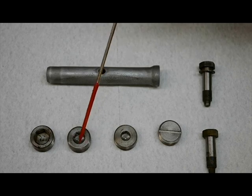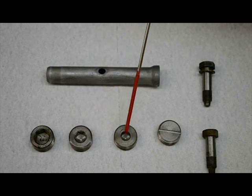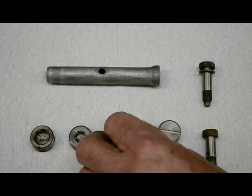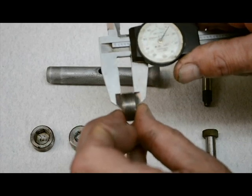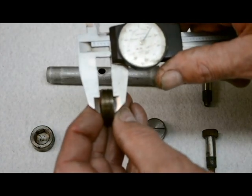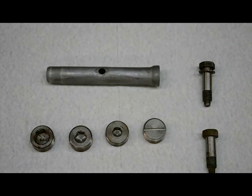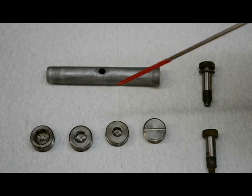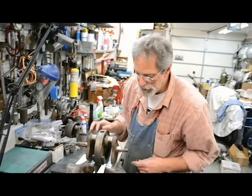This one, even though the hex is smaller, is still tremendously lighter than a factory plug, which is 1.5 ounces. It's thinner — not as thick as a factory plug. This one measures 412 thousandths, while the thinner one with the small hex is considerably smaller at 0.350 inches — that's why it's lighter. The fact that these three are way lighter than the factory plug will throw your balance off left to right dramatically. I don't recommend them. Stick with the factory plug, the heavier one, and you'll be good.